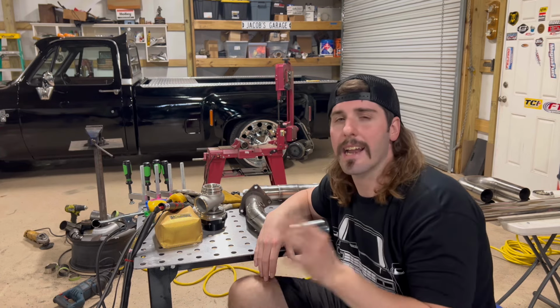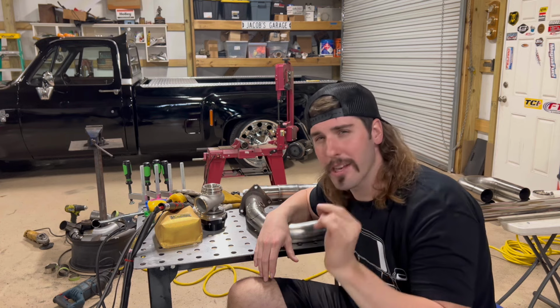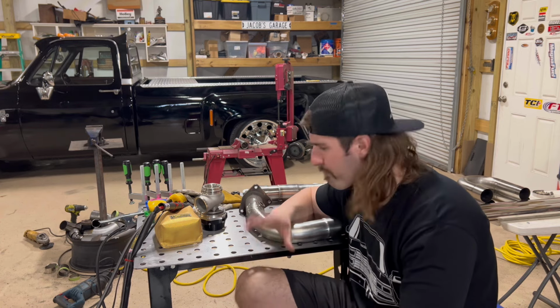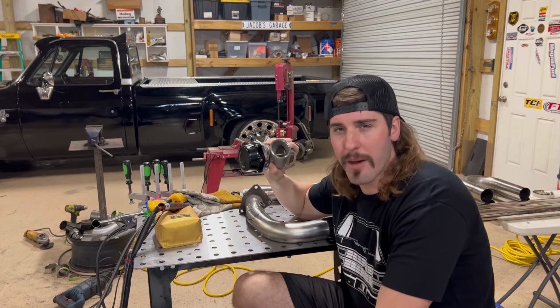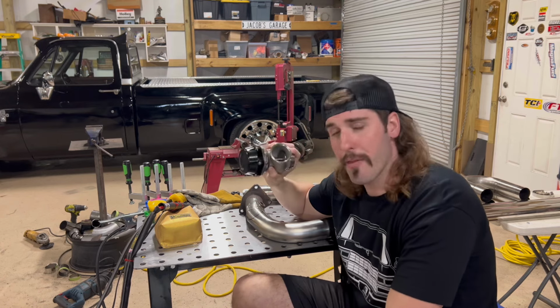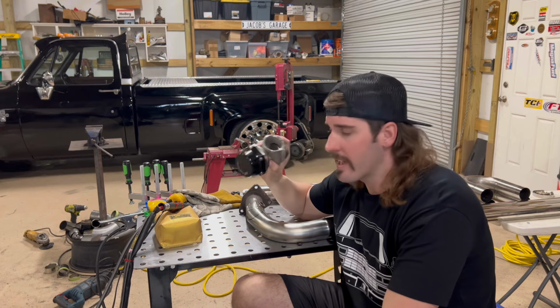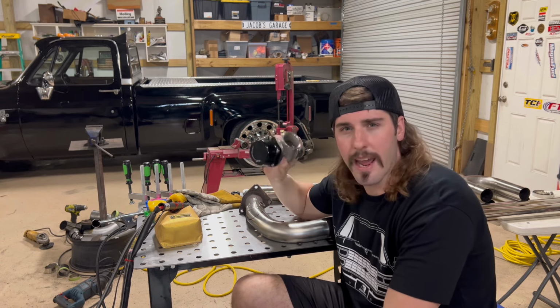And I could not get that car to build a pound of boost with just that little slice in the line. So a 2-inch exhaust leak on the driver's side, whenever this thing does its thing, will regulate boost. And I think it'll regulate boost nicely. And it'll also mount it out of my way. I ain't got to deal with this in the engine bay.